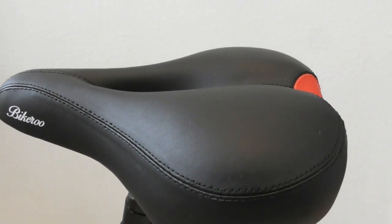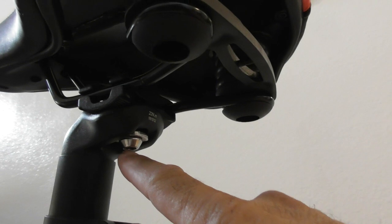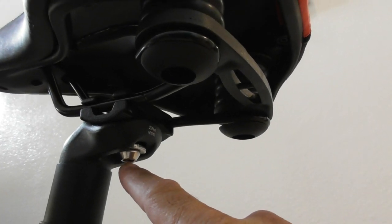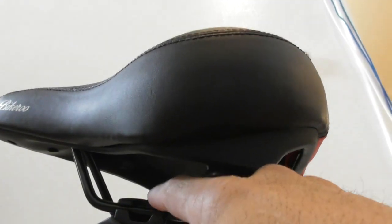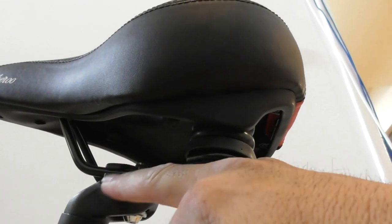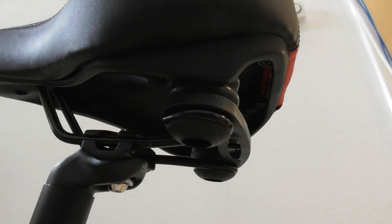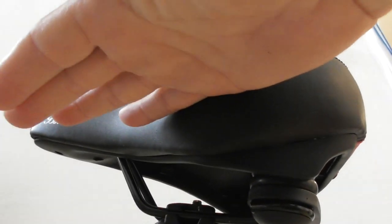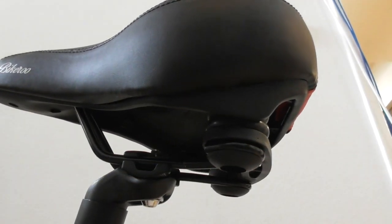So let me show you how to take off your bike seat. If you have a newer bike seat that uses rails for mounting, all you need to do is go by the seat post. Take the 5 or 6 millimeter wrench that's included in the package and loosen the bolt. The seat will come off of the rails, this little top piece will come up. You will take your new seat, put it back into the little indents, put the top back on, tighten the bolt at the back. Make sure that you adjust the angle of the seat the way you want it and don't forget positioning forward or back for your comfort level.